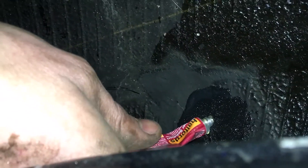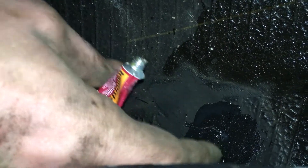Spreading rubber solution out — I want a thin even coating and I've tried to get some inside the hole as well. I'd rather have rubber solution than dirt in there. Having applied it and spread it out, it just needs to sit for a little while to start to go tacky, and that ensures that the patch then sticks properly.